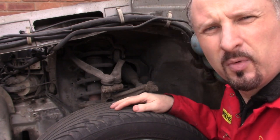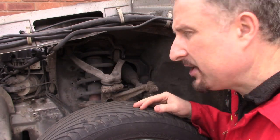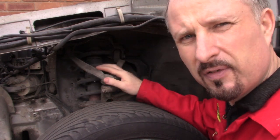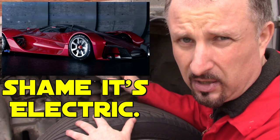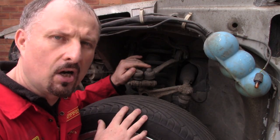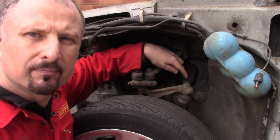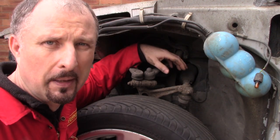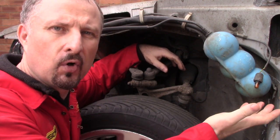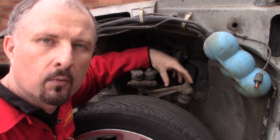The problem I had with using the front suspension from the donor car, which is an Audi A6, is this: the Audi top part of the suspension is above the wheel — it's rather large and rather bulky. It's no good if you're trying to design a low-slung supercar because it's going to interfere with the line of the bonnet. One of the things you might notice is that the steering rack on this car is above the tyre and wheel. This arm here connects to the steering rack, and this proved beneficial for me because as I mentioned in the last episode, I had to cut out a few inches from the floor — I raised the floor up — and this has the effect of lowering the steering rack and column down.